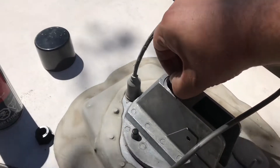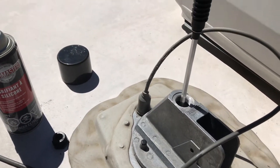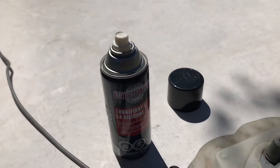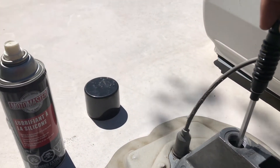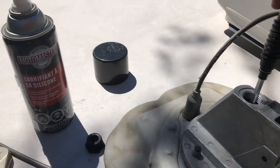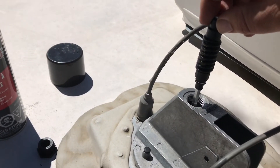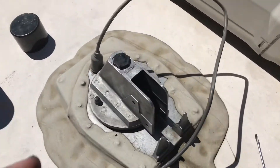Back up on the roof with the new worm gear. I've put the washers on and cleaned out the inside to make sure there are no little bits of plastic left over. I'm going to lube the bottom of this a little bit — they say to use a silicone lube since they don't want anything petroleum-based eating away at the plastic. Drop this in, put the cap back on, and then proceed with hooking up the arms.